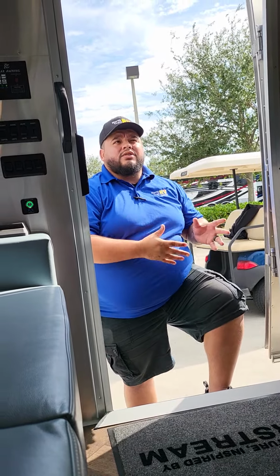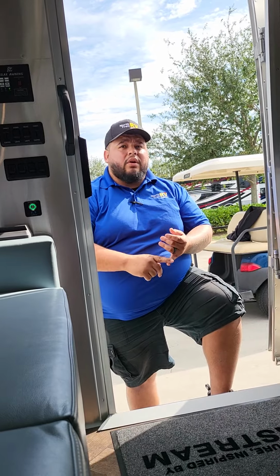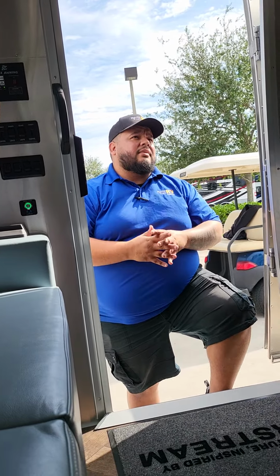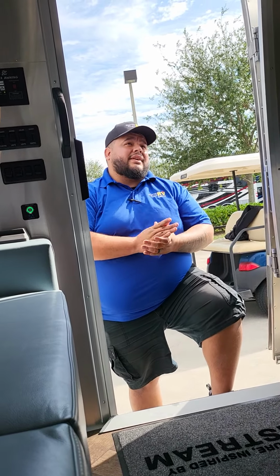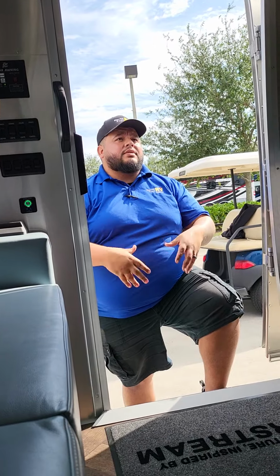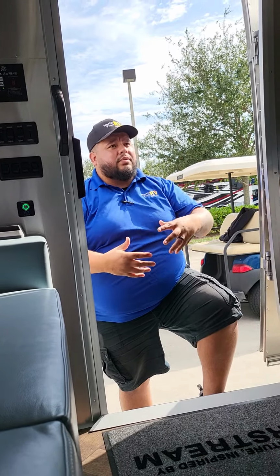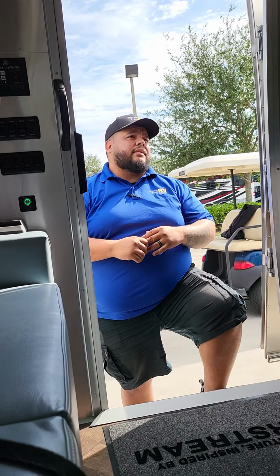That's why they said for dry storage, just disconnect it, so at least nothing's drawing out of those batteries, where then you have to constantly replace your batteries because they're either dying too quick on you or they just harm. One of the cells inside the batteries harm themselves. If you have somewhere to plug in, it's probably the best ideal thing to do because you're exercising that battery. It's getting the charge, it's using the battery, and then constantly putting it back in with the charge, whether that's a 120 outlet, a 30 amp, or a 50 amp.